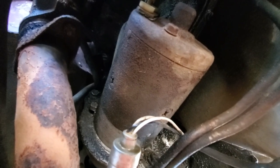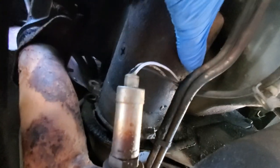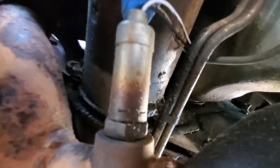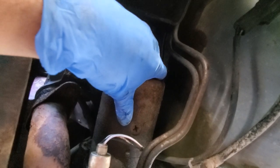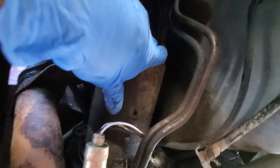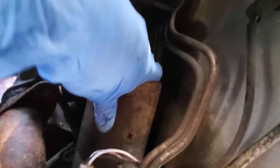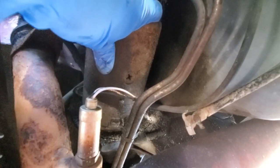I've gotten both the top and bottom bolts removed and you can see the starter is now loose. I'm going to need two hands — we're just going to pull it down through the opening here. Watch out for these — I think these are transmission lines. You don't want to clip the wiring on your oxygen sensor there, but there should be enough room to tip it out of here and get it on the ground.